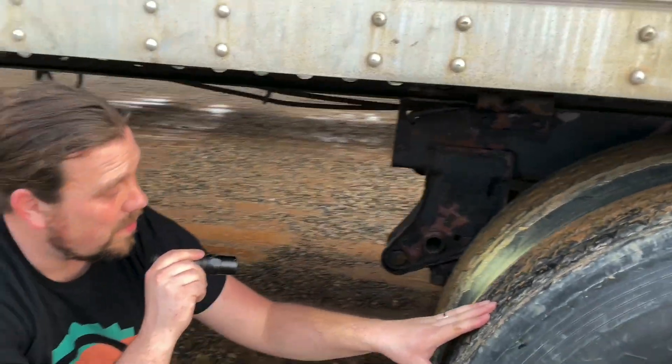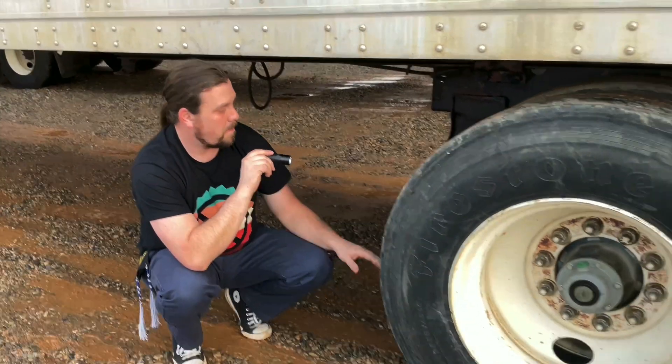On my front trailer axle I have dual tires, so I'm checking to make sure there's nothing between the tires. I have budd wheels, meaning they have no spacers. Tires on the rear of the trailer must have at least two thirty-seconds inch tread depth, can be regrooved and recapped or retreaded inside and out, can have no cuts, bruises, or blisters, and must be 90 to 100 PSI — checked with an air gauge. There must be a metal cap on the valve stem.